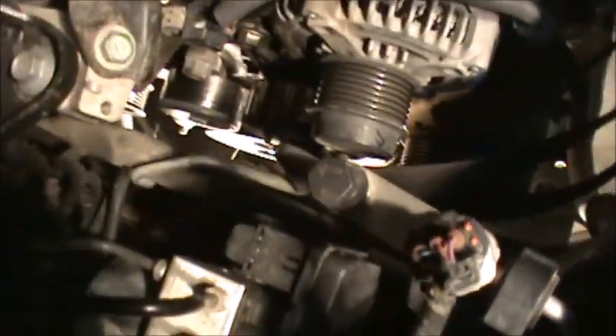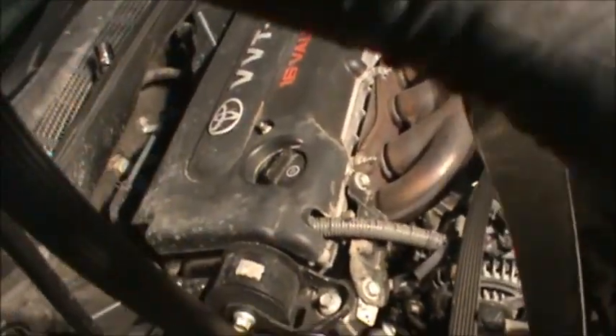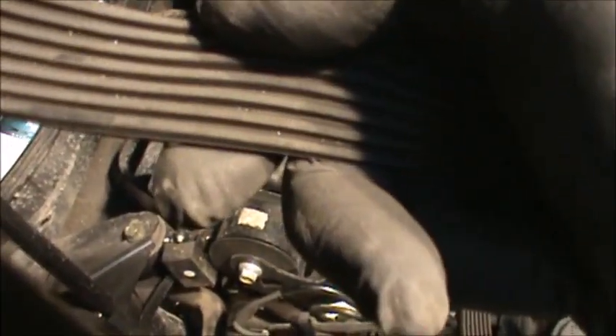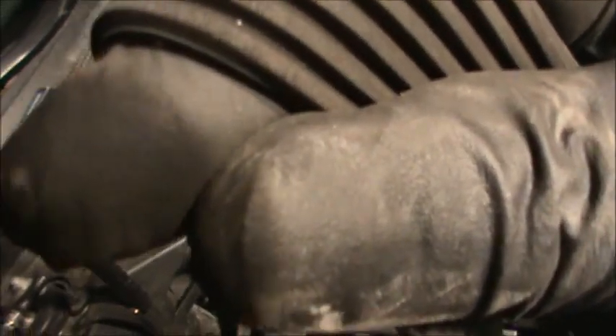It's a little annoying, especially if you're in the middle of the road with it broken — that's why we're doing it now. Sometimes with some belts you can put them on the wrong way, so make sure before you put it on. Believe it or not, this belt has 150,000 miles on it. Doesn't look too bad — it's because they put a good belt on it — but you can see it's starting to have cracks.